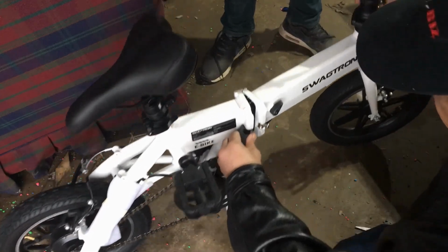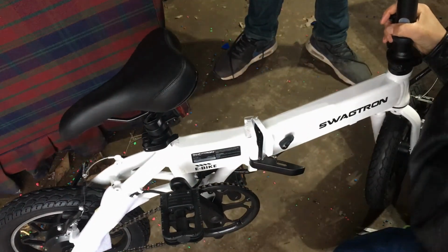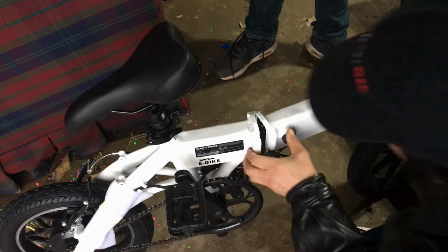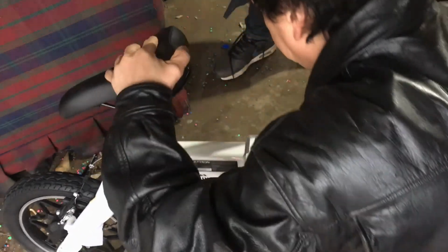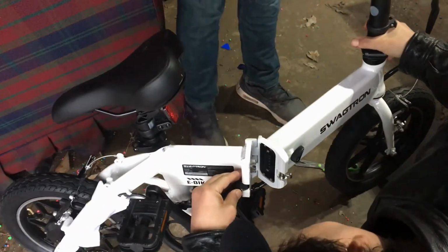Before each ride, especially if you may travel a long distance, inspect your bike first. Check the tires for proper inflation and cracks on the walls of the tires. Keeping the tires properly inflated and maintained will help prevent flats and damage. Second, check all cables and cable housings for fraying, breaks, rust, or corrosion and replace if necessary. Lastly, inspect the brakes to make sure they are working properly.